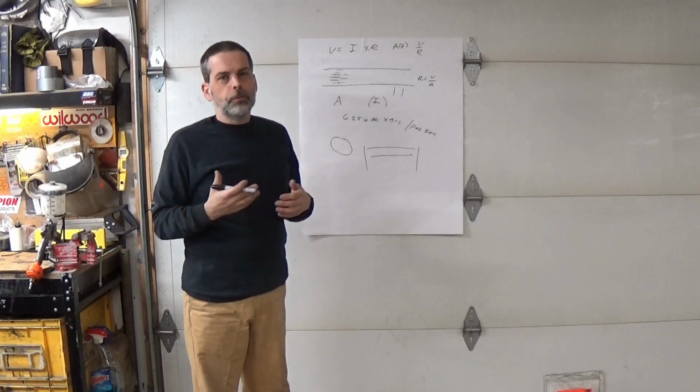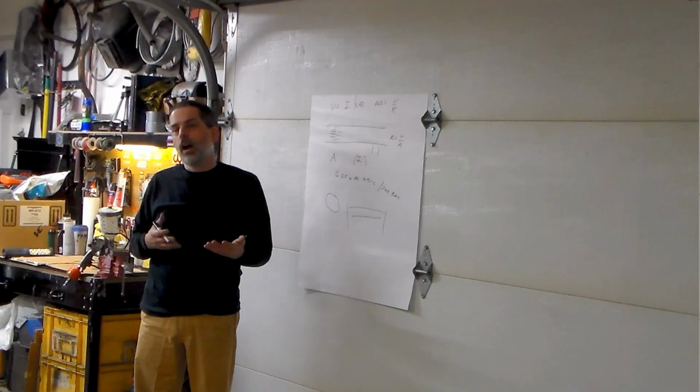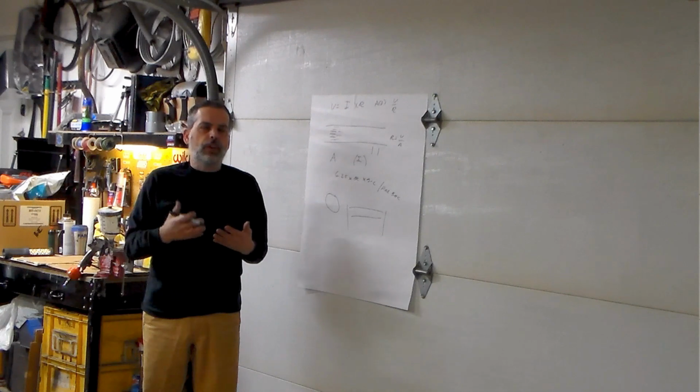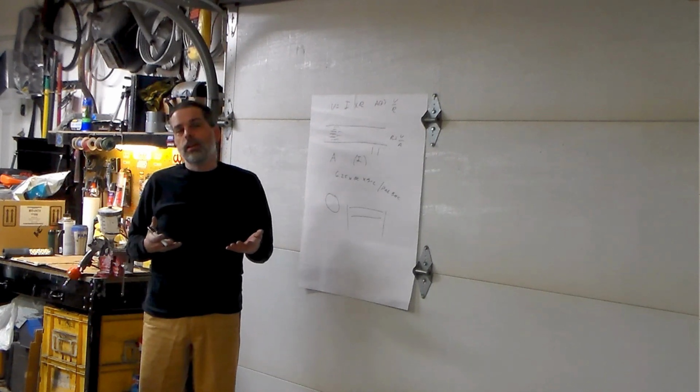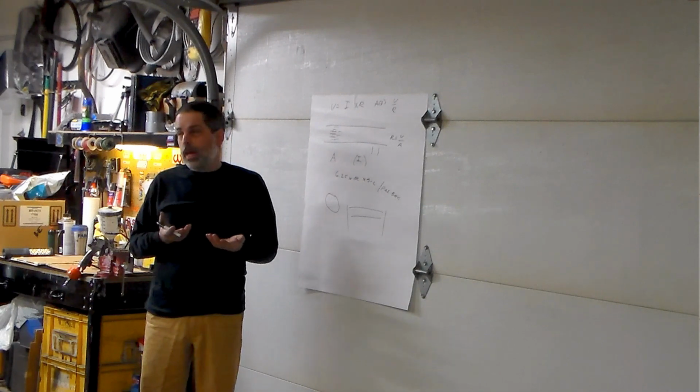So a lot of times, when I've worked on cars that were in accidents and they have dim lighting in the car, it's because the car was fixed structurally and repainted, and when it was, they have a dirty ground somewhere, or the ground was painted or something like that.